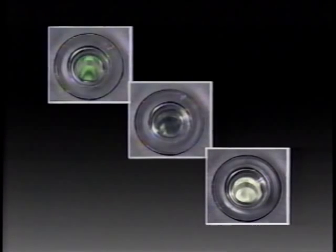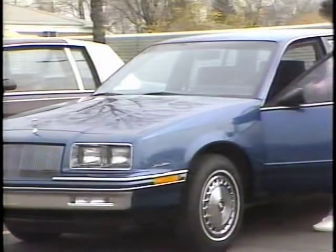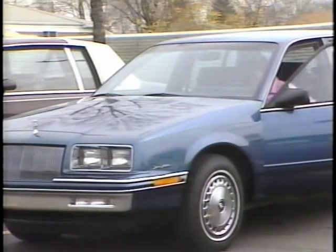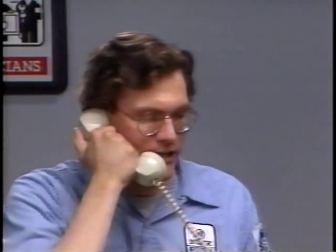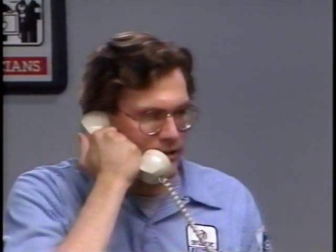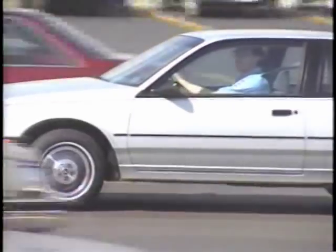Using the built-in hydrometer is one way to help diagnose a battery problem. There are lots of possible reasons for a discharged battery — most often it's a symptom of a problem somewhere else in the car. Talk to the customer, find out what sort of problem they're having. Is it really a battery system malfunction? But don't rely on the customer's word alone — experience the problem yourself so you can verify its exact nature.